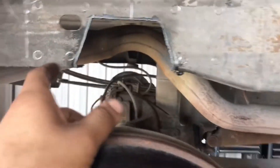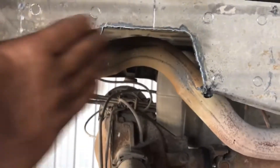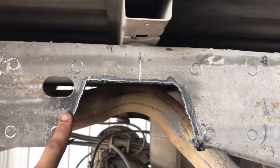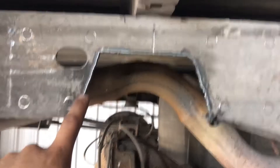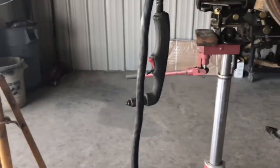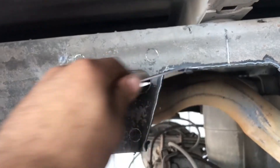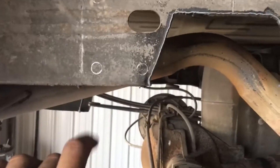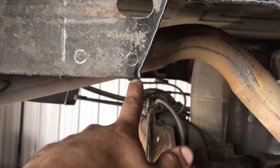This is how it looks after it's been cut. I did a pretty clean cut where I don't need to cut more than I need to. That's the main goal whenever you do a C-notch - try to mark it where the C-notch is going to be, how I showed you when you sit it in there. Get something sharp and just mark it - that's how I marked it earlier in the video.